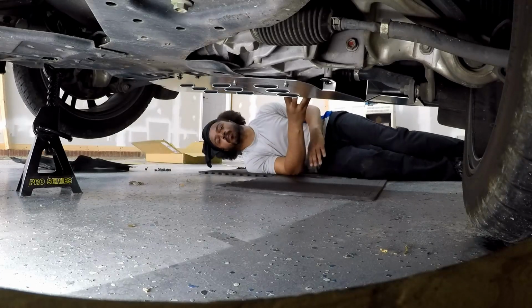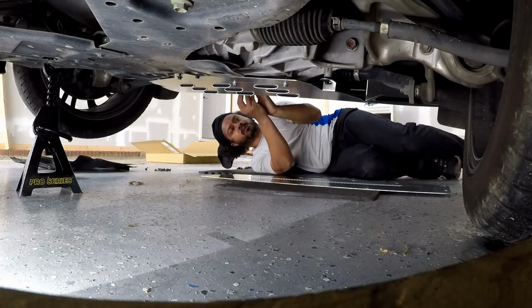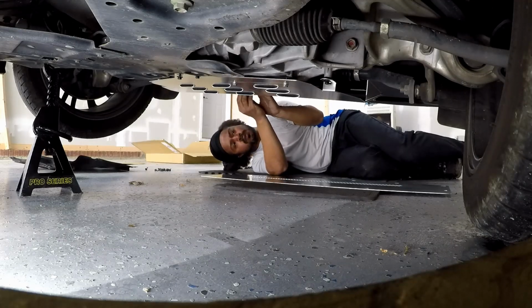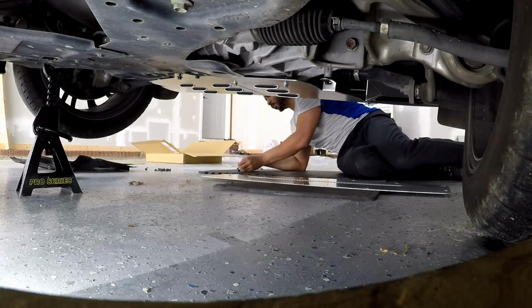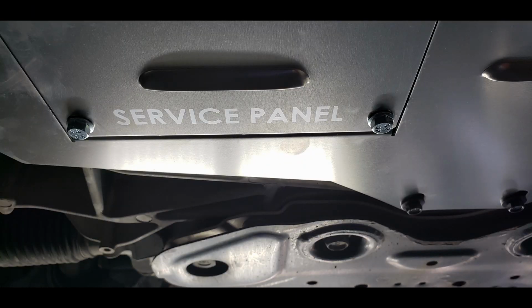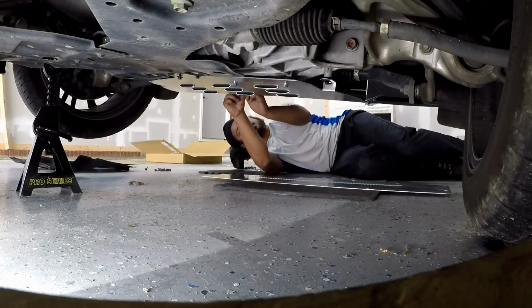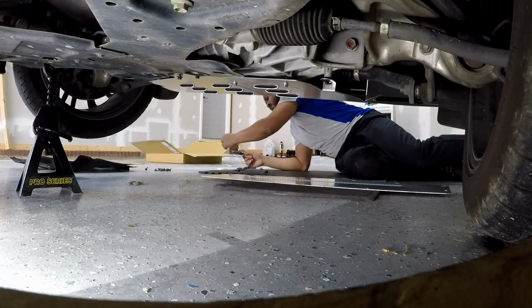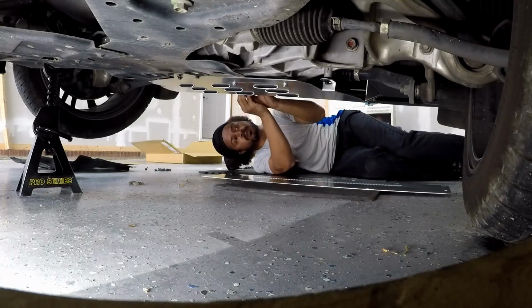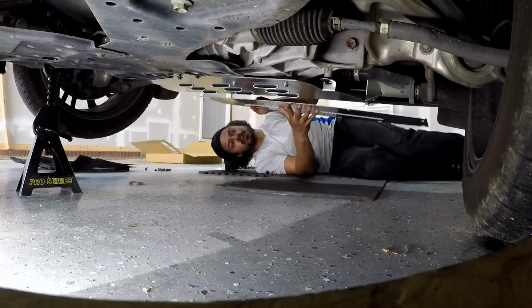And Infiniti design, all the Gs and the Qs, they are what they call zero lift cars. So if you drive pretty fast on a highway or go to the track, you'll see that these cars are very stable under higher speeds. And part of it is the cars actually do have some aerodynamic considerations to it. And this undershroud seems to not kill that, how they did the vents. You keep that. You see most cars these days are flat bottom, and the flat bottom is for aerodynamics.